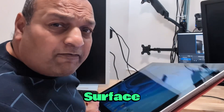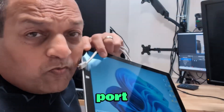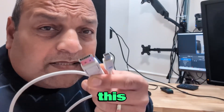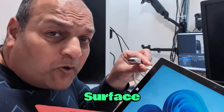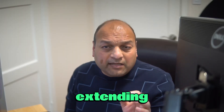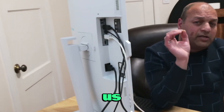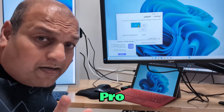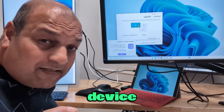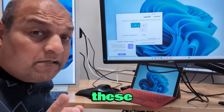This Surface Pro 3 is a 7-year-old device, but it's far from obsolete. It has a mini-DP port which also supports MST and thus daisy-chaining. Using a mini-DP to DP cable, we can easily link our Surface Pro 3 to the monitor and extend to a second screen. With just one cable, we establish a video connection extending the Surface Pro 3 display to two monitors. Same as the mini-PC, a USB-C to USB-A cable allows us to attach USB devices directly to the Surface Pro. A 7-year-old device seamlessly integrated into a modern setup — proving that even older devices can benefit from these new monitor features.